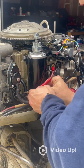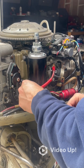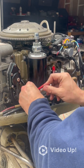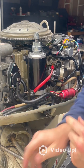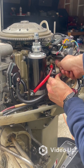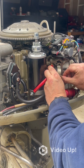Let's reconnect the wire. This starter did come with a new nut, so we'll put that new nut on and tighten that down. Now let's go ahead and reconnect this back up in the position we wanted. We did bend that a little bit, but that's okay — we're getting this back into position pretty easily.